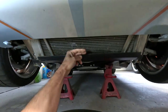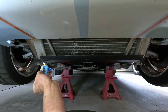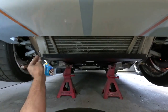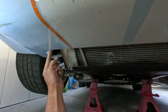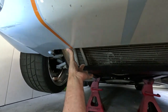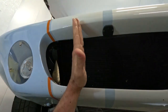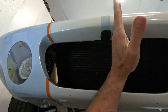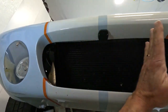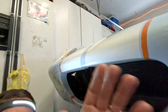What I'm thinking of doing is welding a small plate tab all the way across — that'll strengthen this really thin eighth-inch metal. Then I'm going to bolt this conveyor belt material up at a slight forward angle, which will create a higher pressure zone in front of and below the radiator, drive more air through the radiator, and reduce the amount of air going underneath. I may also try cardboard over the front with tape to test how large the nose opening really needs to be aerodynamically.